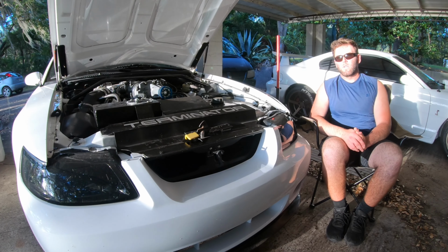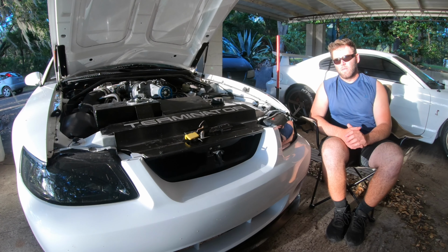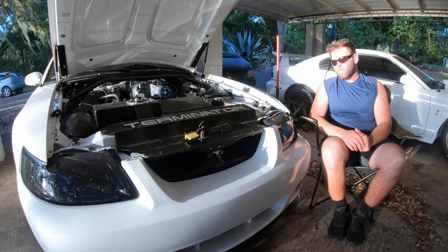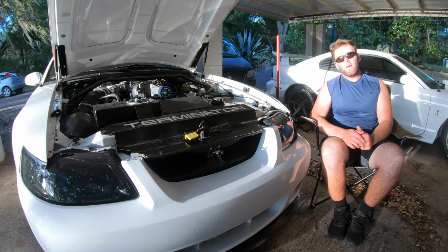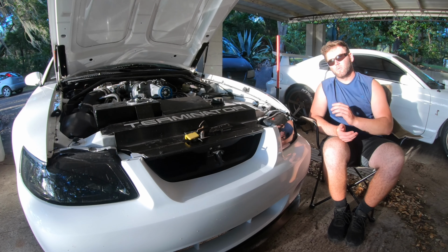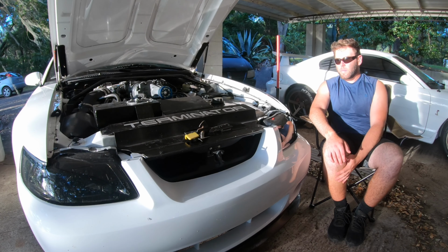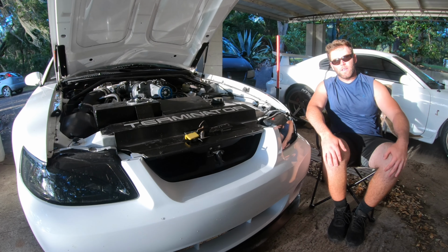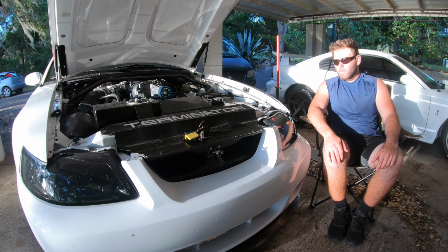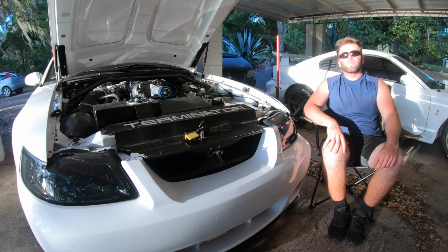So the car was really tampered with before, and I have a theory. As we all know, the 4.6 4-valve motors suffer with the dead head on the driver's side head. It's not as commonly talked about in the aluminum blocks because aluminum dissipates heat a lot better, and they're also not positive displacement supercharged like the Terminator. So your heat soak isn't nearly as bad. But once you do overheat the car, it's pretty catastrophic since you can alter the metal a lot more with aluminum.